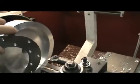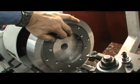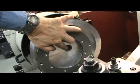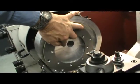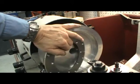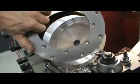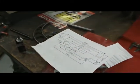He's not quite all the way there. This is going to set down inside of here when this is cut a little farther. Bored this through hole so that his cutter doesn't have to go to center and chatter every time it swings in. He's going to be cutting this a little deeper, cutting it a little bit wider, so this can be mounted down in the bottom and make up the difference. When this is put back in, we'll have the correct depth from here to the face of this, and then the clutch will rub on this face. So we'll get some shots when he gets this cut out a little farther.